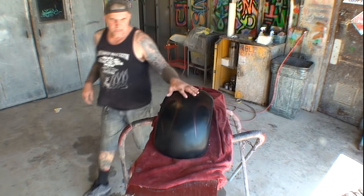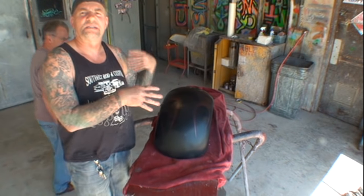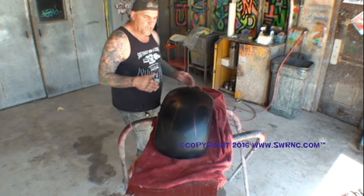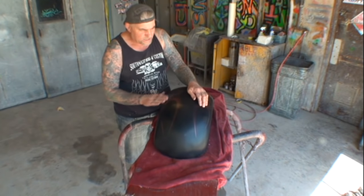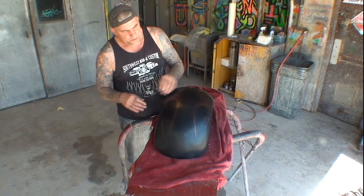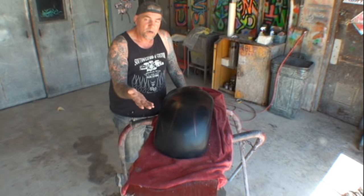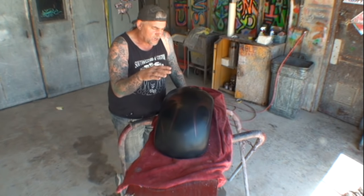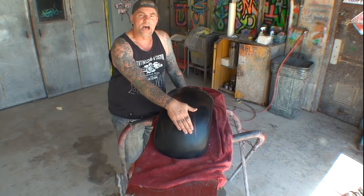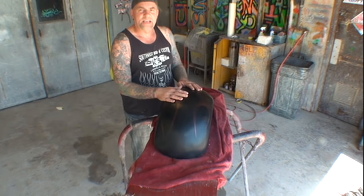So now that we got our fender done, we're going to go ahead and swap from the tank to the fender because we're doing the same thing. I want to go ahead and put one more set of flames on this. Now there's two ways we can do that — we can go ahead and tape the flames off and let the blue pearl land on top of the red pearl, and it would look like they're intertwining. Or we can put our flame on and then wherever the red is, we take that off. Remember I was telling you about your first flame being your bottom flame? So we got two choices — tape them off and have the blue pearl riding on top, or tape them off and pull the red. Let's get our flames on there and see what we got.